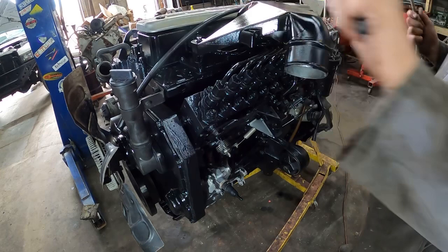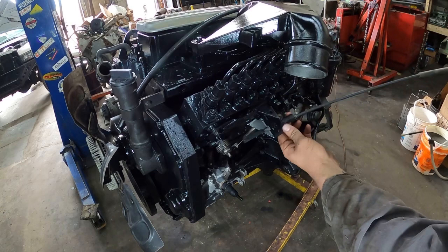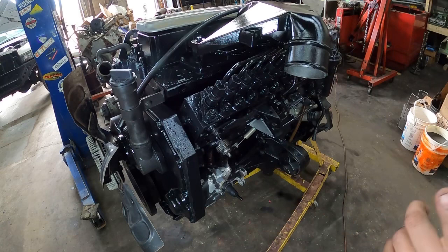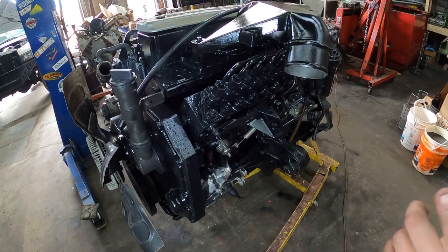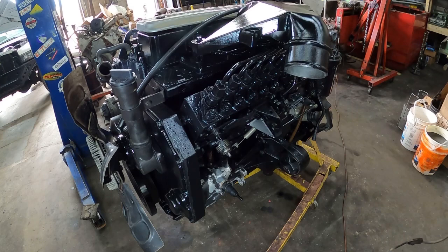This is a TV cable right here. This piece is usually going to be on the engine side, and this is on the transmission side — it's usually bolted to the back of the transmission. Then this goes onto your TV cable lever. Something to note is there is a spring — I'll try to put a picture here — there's a spring that goes from the transmission bell housing to the TV cable that holds the TV cable pulled all the way forwards in rest position.